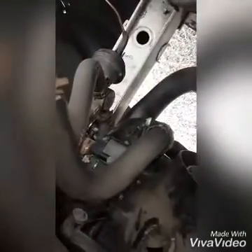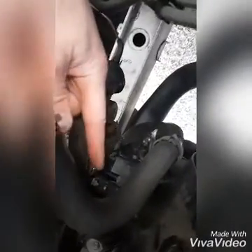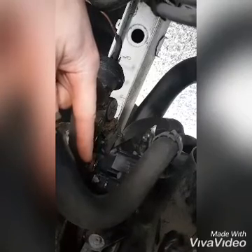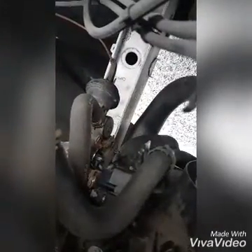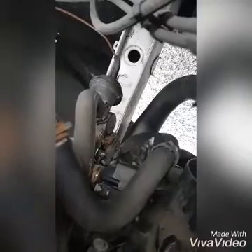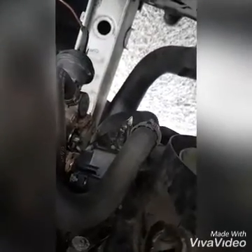Then you've finally got the third one, just here. This is the one that runs all the time. There's the block connector for it — it's on the front right-hand side of the radiator as you're sat in the driver's seat. It's a three-pin connector: you should have 12 volts on one wire, ground on another, and a signal wire between three to five volts.